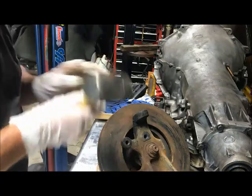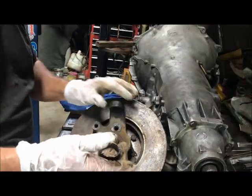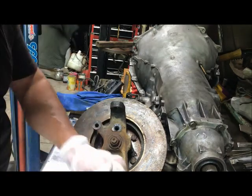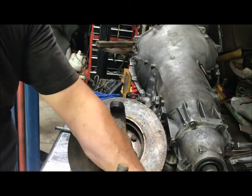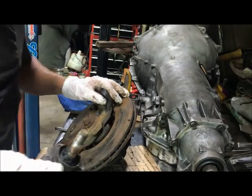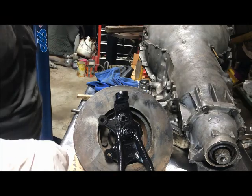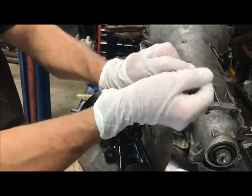The three-piece ball joint has a lower bottom piece, a ball, and a race inside that we're going to knock out. The reason we're knocking it out is that the replacement ball joint is from the later XJ40 platform and it's a one-piece unit, so you get rid of all this, bolt in the one piece and you're good. Some people missed the fact that there's a race inside here and tried to bolt the XJ40 joint in without removing it - it doesn't work. Drove it out with a long homemade punch.